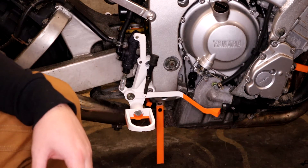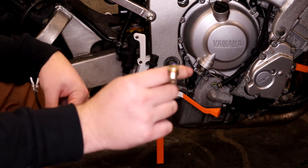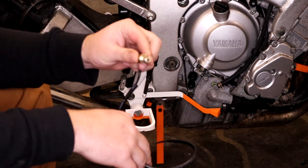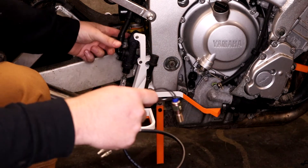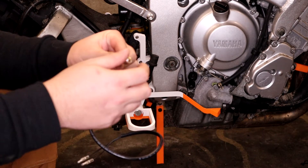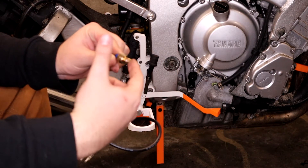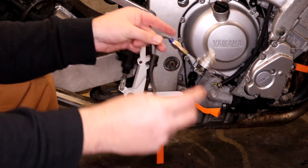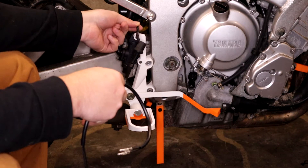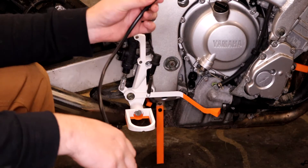The first one is this — a new brake light sensor. This thing replaces the banjo bolt on the backside of your master cylinder and contains a little pressure switch inside. So instead of pulling on a little string to close the circuit, the pressure switch closes the circuit, and that's what causes your brake light to turn on. We'll run this up here, cut the wire, put on matching ends, and plug it in.